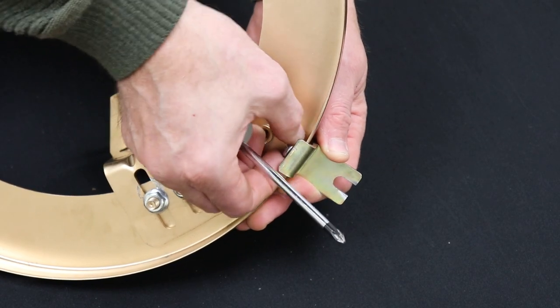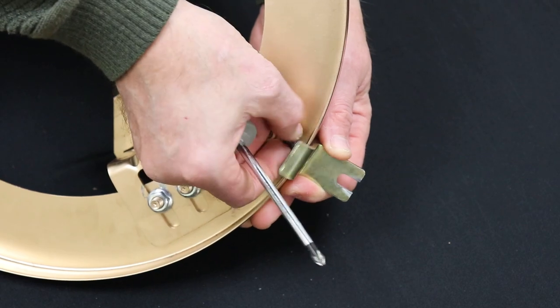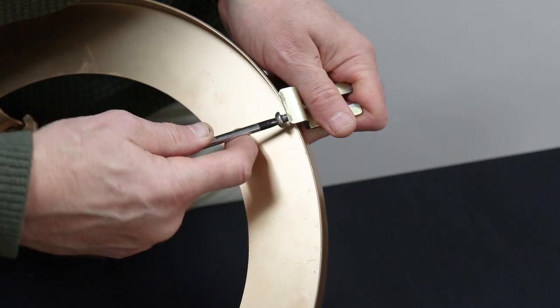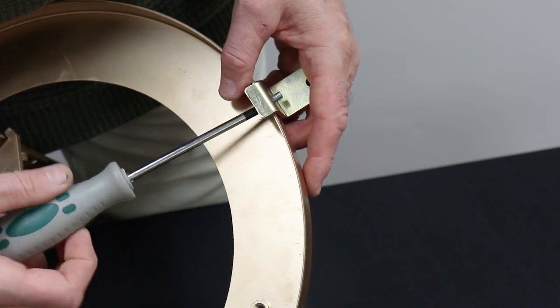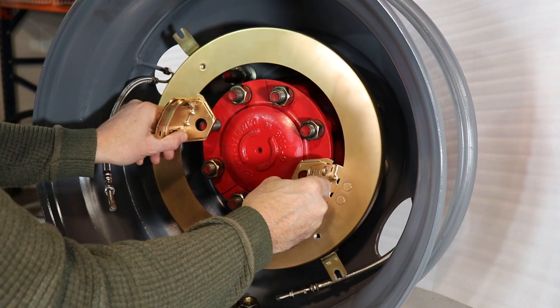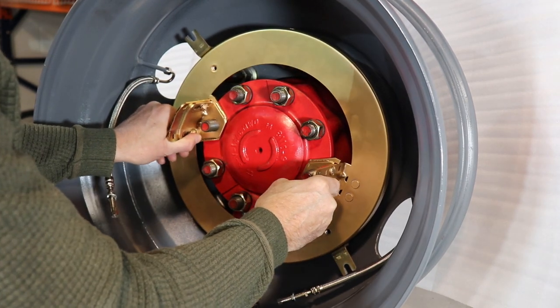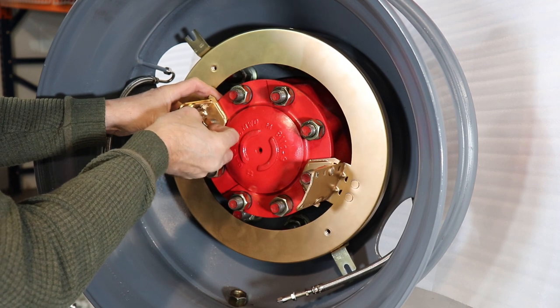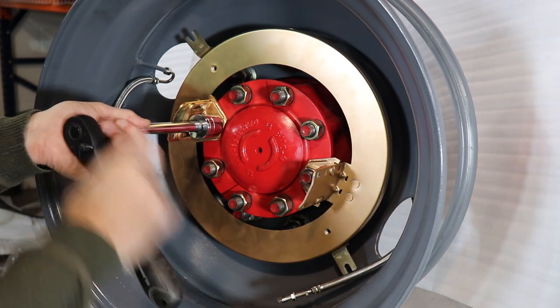Please note, if needed, one of the air valve tabs can be relocated to an alternate position to better accommodate the air valve extensions. Now remove the two axle nuts that you identified. Place the ring bracket over the axle so the exposed axle studs pass through the holes of the slide brackets. Replace the two axle nuts and tighten them securely.